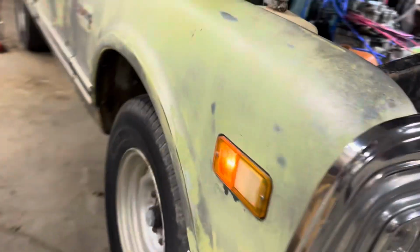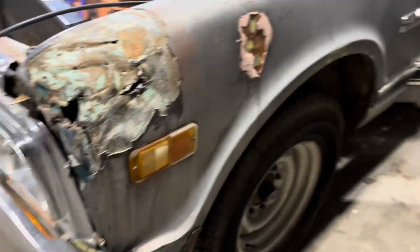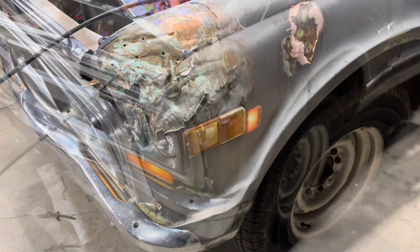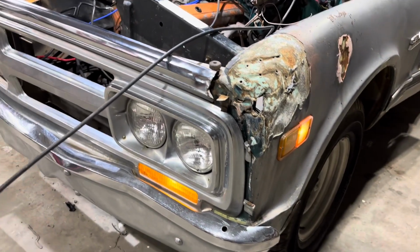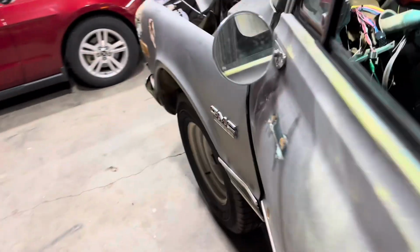They're hard to see, but we got the front parking lights now. And those side markers. Oh yeah, there's one. So this one must be burnt out. Okay, need another bulb. All right, so our turn signal works. It's not blinking because I don't have power going to it. Just have it turned on. But the running light doesn't work, which is weird, because this turns on everything except for that one corner lamp.